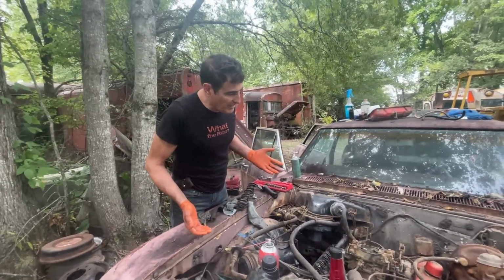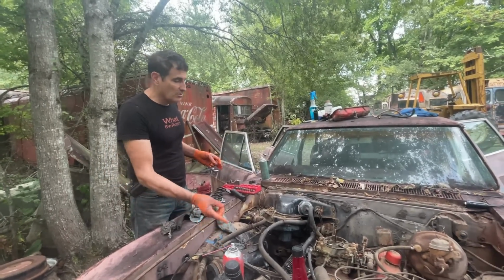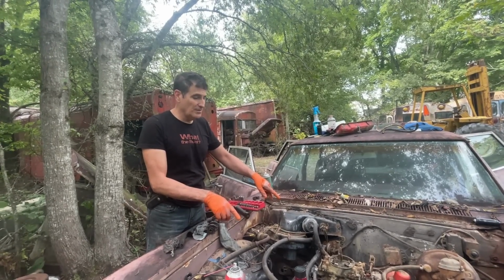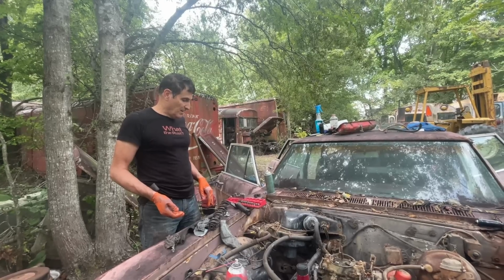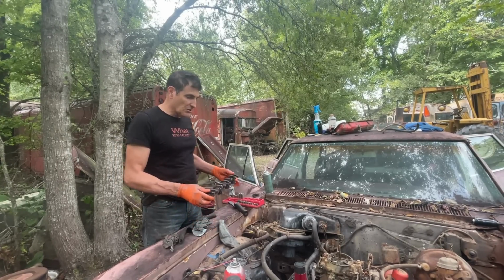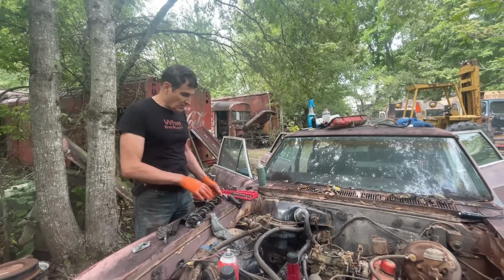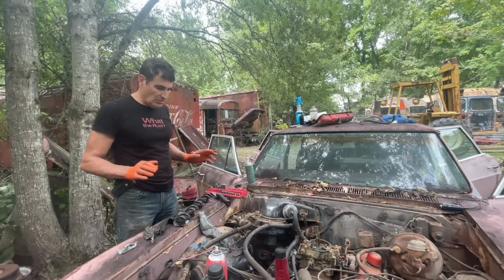No. I've even blown air through it. And at first I thought, well, maybe it's a return. Maybe the oil comes up and goes through. But I don't think so because the return holes are in the heads. Mm-hmm. So it might be a return, but I'm not banking on that. What I'm banking on is this is all clear now, and it will help blow it out when the engine warms up. So I'm going to cover this in oil and install it, and then we'll go try it.